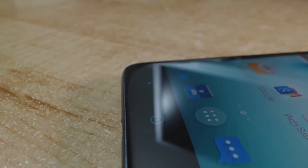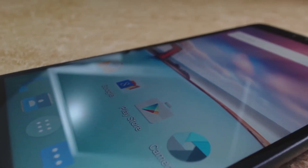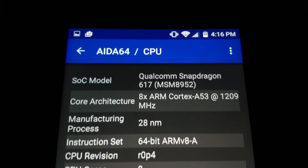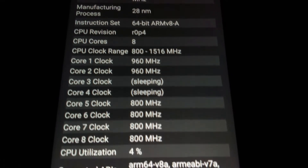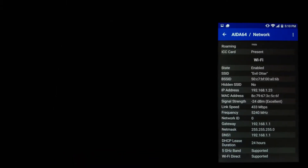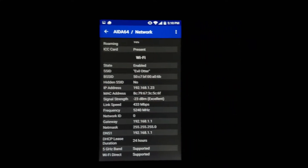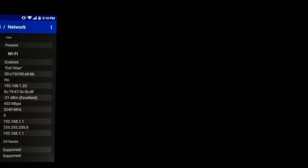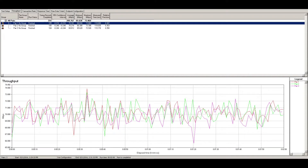After about one day of use, my first impressions of this smartphone are pretty positive. I was pleasantly surprised to see slightly better specifications than what was listed on the box, which includes a slightly better Snapdragon 617 SoC as well as 802.11ac, which is provided by a single-stream Wi-Fi radio allowing for a maximum link rate of 433 Mbps. This provides a sustained real-world throughput of a little over 200 Mbps.